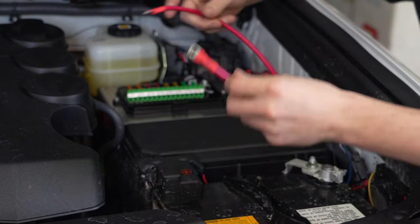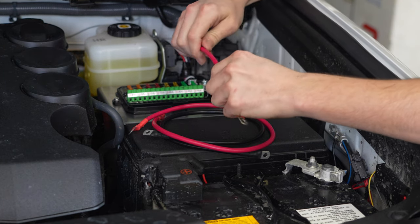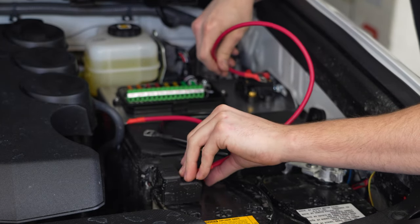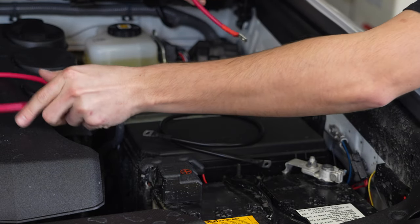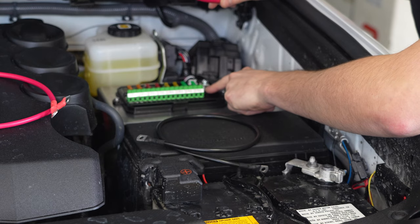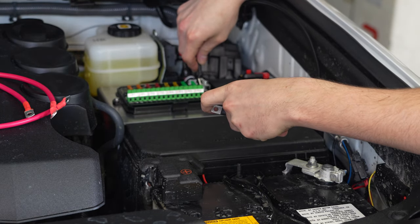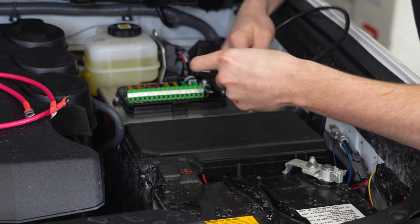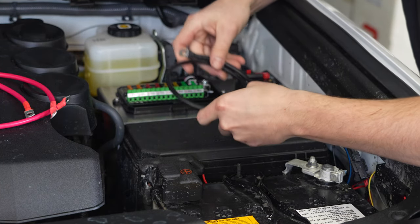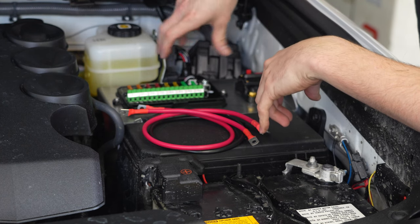When it comes to wiring the kit, it's fairly simple. You're going to have one long power wire, one long ground wire, and a short power wire. The long power wire runs from the battery to the circuit breaker. Then the shorter one goes from the other pole of the circuit breaker into the fuse box and onto the positive terminal. The ground wire goes to the negative side inside the fuse box, routed out and then to either your chassis or your battery. The wires might need to be adjusted in length to fit properly with where everything is located.